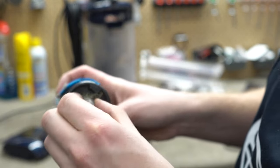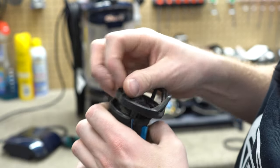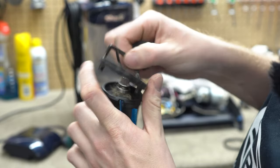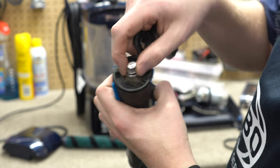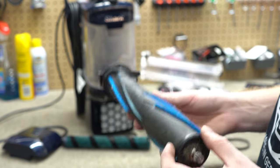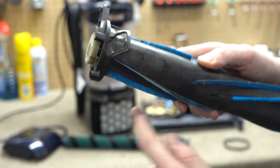The bearing is seized with hair because the anti-tangle portion simply just doesn't work. Again, I'm not the only one with these findings — this is what I said would happen a year ago when I first saw this machine, and it has happened. You can see the melted hair. The roller is relatively clean; everything is clean on this machine, so this is really melted from the hair. You can see where the hair actually goes into the bearing.